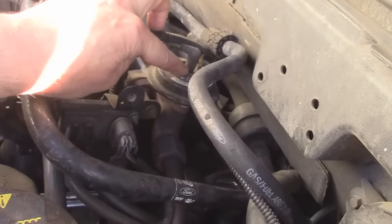Sometimes the engine will bog down and then speed up, sometimes it'll speed up and then bog down. You also have to wait and be careful of natural engine cycling — the engine might be idling up and down on its own so you don't mistake that for a vacuum leak response. I think if there is a vacuum leak, it's happening back here in this area.